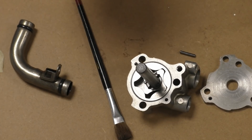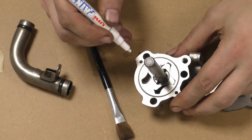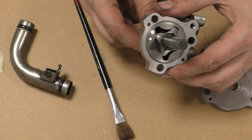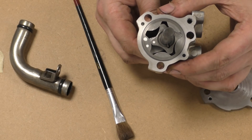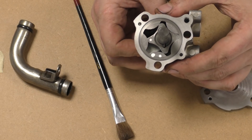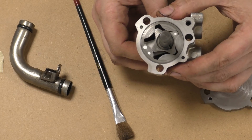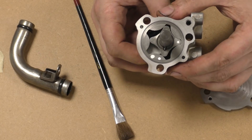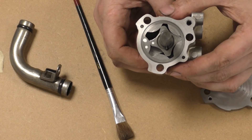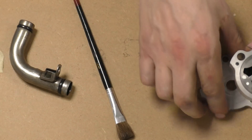I've got a paint marker here — I'll dot that rotor and that one. That's quite clear. You can see we're lined up there. Then as we rotate, the inner rotor will race ahead. See, the outer rotor is turning slower than the inner — as you can see it's catching up. And we're back to equal again. You notice that relative to the mounting holes in the plate.